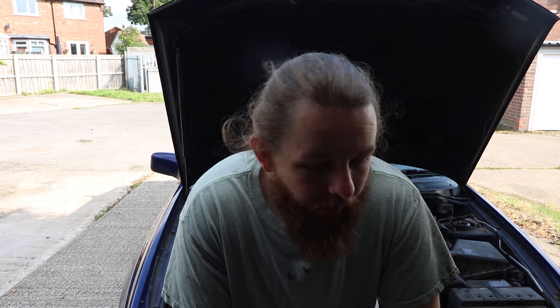We're back the next day. I'm going to now take off the engine cover again and do the fuel filter. You have to manually prime these ones with a squeezy bulb thing — on these old Renault 1.9 DCI engines. So we'll change the fuel filter, we'll bleed it, and the car should fire straight up with no airlocks in the system, fingers crossed. It's not self-priming and self-bleeding like the newer Volvos. I'm also waiting on a few other little bits for the engine bay — there's an o-ring I need to change where it's spewing oil out at the minute, so it's not worth detailing yet. We'll get the fuel filter sorted and then it's fully serviced.